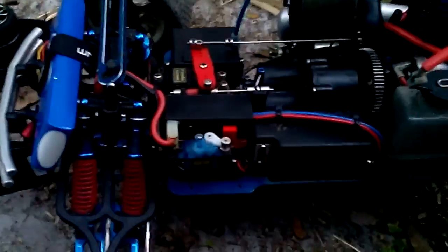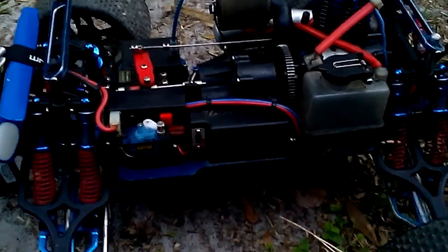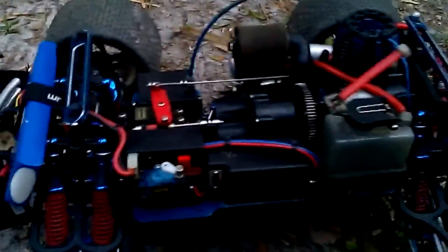I have it grounded to the left side header screw, and then there's the glow plug wire. That does go bad, so it is accessible right here to disconnect and replace just that part. It's incorporated pretty well — looks pretty clean, nothing piled on top of one another.